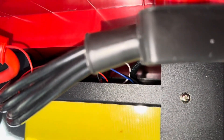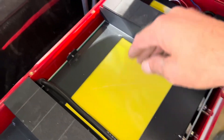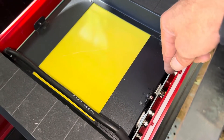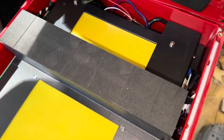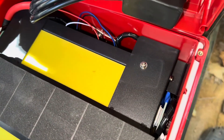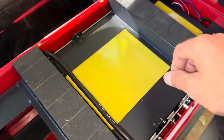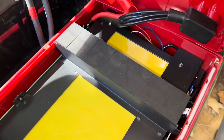The JBD BMS is right there — it's the contactor-based one, similar to one I did on a previous battery. We've got six cells down each side. It's using printed circuit board cell connectors instead of regular bus bars — I like those PCB connectors. There's metal casing all around, epoxy board everywhere, fully stabilized. Here's our series jumper between each set of six cells — it's using a four-gauge jumper to bring them up to 38.4-volt nominal.